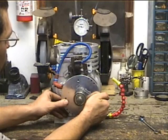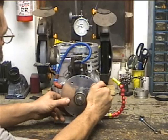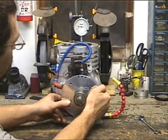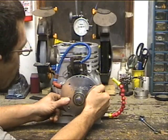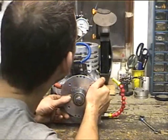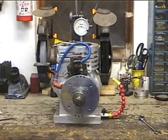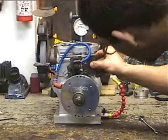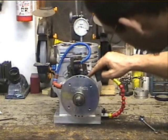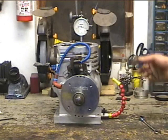Alright, where are we? There's zero. Come back — a little bit past. Come back up. Sorry if I'm getting my head in the way. Three hundred and fifty thousandths. Take our little plastic gauge that's not magnetic — and as you can see, the edge of the coil is lined up right with that edge of the magnet. And that is how you set the coil ignition timing and the air gap using the in-the-hole method with a 3 horsepower flywheel and the adjustable timing bracket.